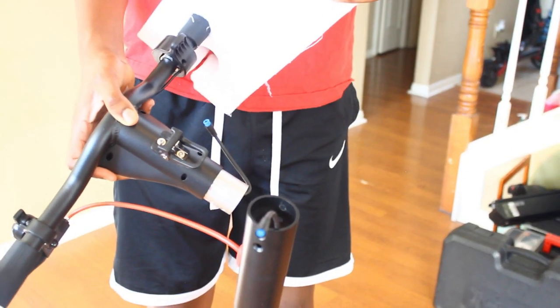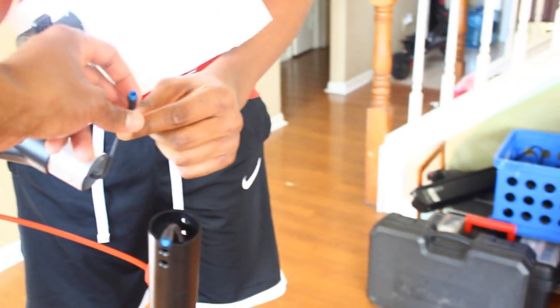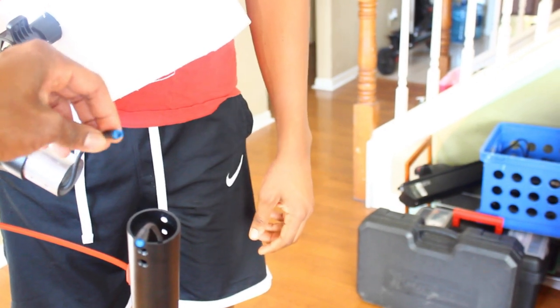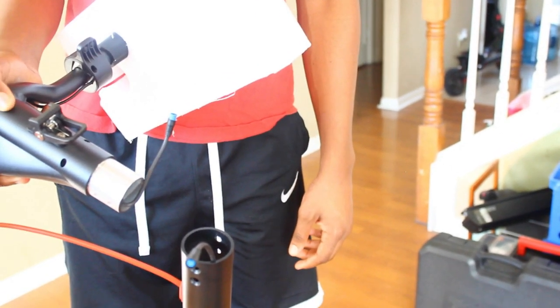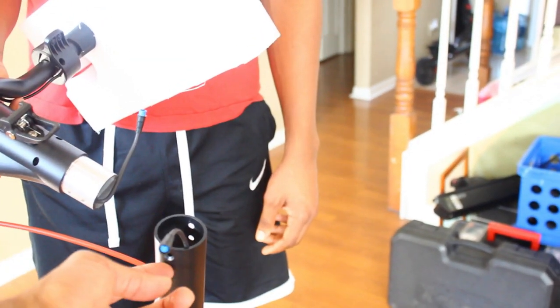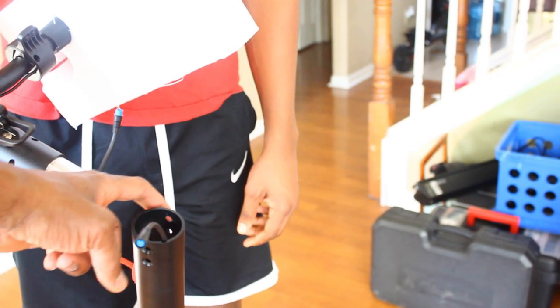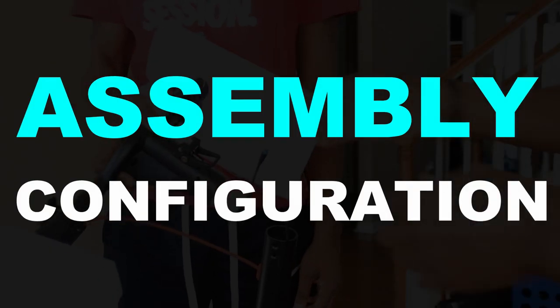So it looks like it's going to be pretty easy to put this handlebar on. First we have to connect these wires — we're going to connect this wire with the blue tip here to this wire that's on the handlebar. Then after we put it in place, we're going to have to screw it in place here on the side. There are also two more screws on the other side, and I think that's it. Ready?